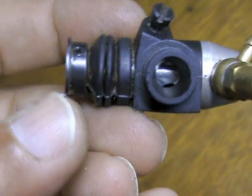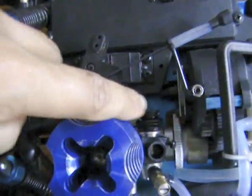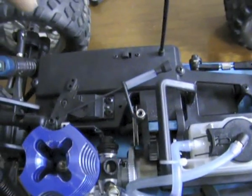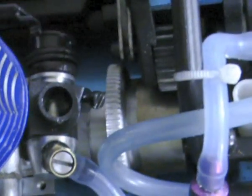You can adjust the throttle servo arm. You can always use the adjustments from here and adjust this push rod so that you get only a millimeter carb opening. When you are setting these things, make sure your radio and your receiver in the car is turned on so that you can also adjust throttle trim, thus adjusting your servo and setting the right gap. After that, you can also use the idle speed screw to set the right gap, that is one millimeter opening.